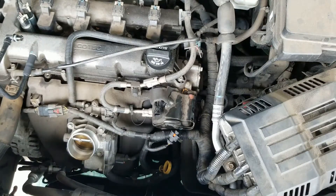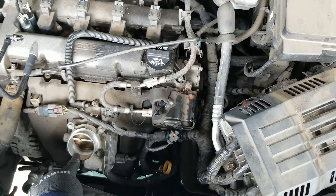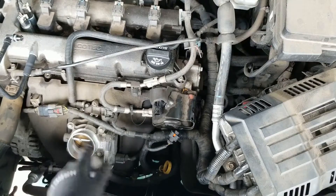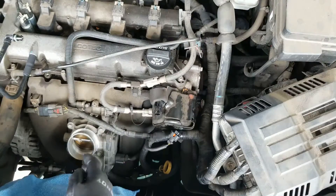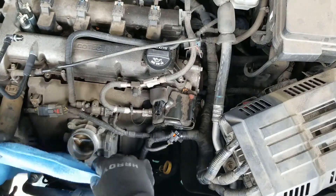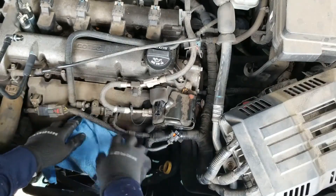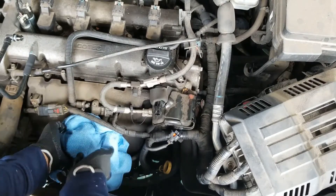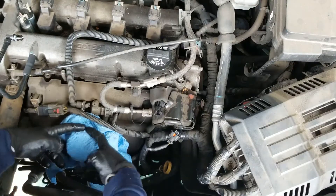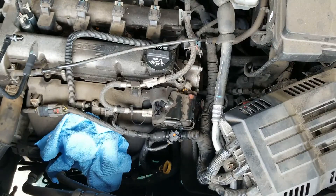One thing I take as a precaution — it's always a good idea at the throttle air intake to put something over the throttle butterfly. It's easy to drop something in there and it goes straight into the engine. Put some kind of cover on it like a rag, maybe a little rubber band to hold it in place. That should be good enough. Now back to the pump cover.